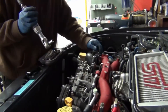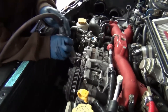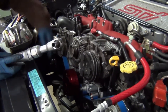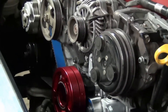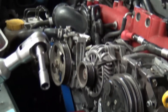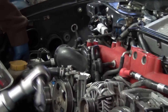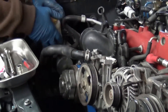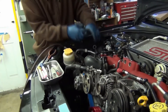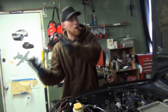Next up we're going to pull the power steering. I had to get this little line out of the way — of course I marked that beforehand. We've got a fancy lightweight harmonic balancer, so that's going to be a bit of an issue — I'll have to use some extensions to negotiate around that. With the air box gone, you can see the power steering pump line that comes over here with the reservoir. We'll undo the reservoir by pulling the tab back and pulling it up, then just undo the bolts and take the whole thing over here. You want as little interference as possible — a nice clear straight shot coming out.